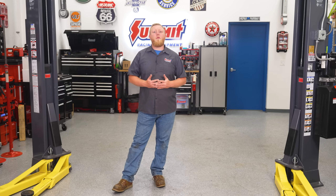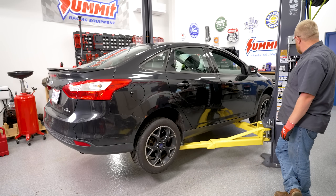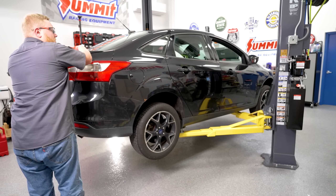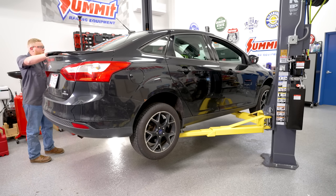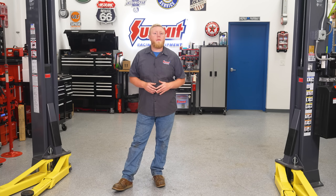With the arms set at the proper lift points, it's time to get this vehicle up in the air, but before we do that we need to do the shake test. Take the lift above the first set of safety locks, set it on the locks, and walk to the front and back of the vehicle shaking it slightly as you go. The vehicle should feel secure and not tippy or unbalanced. If you're uncomfortable or feel like it might tip, take the vehicle back to the ground immediately, readjust, and repeat this process until the vehicle feels secure. Do not — we repeat, do not — take any chances under an improperly lifted vehicle.